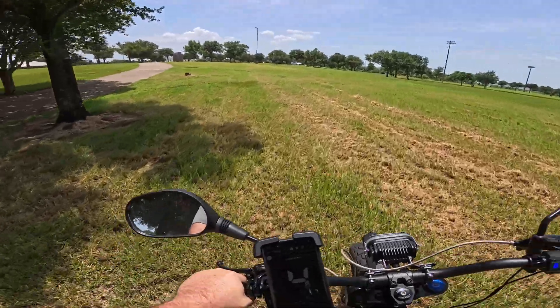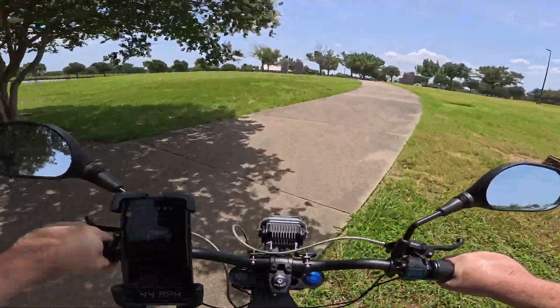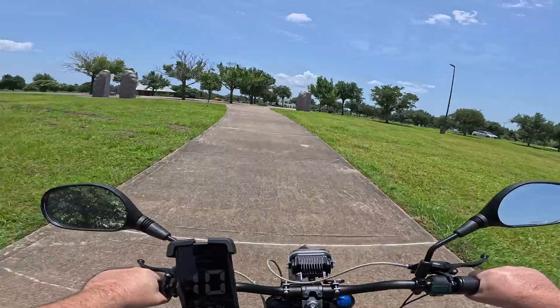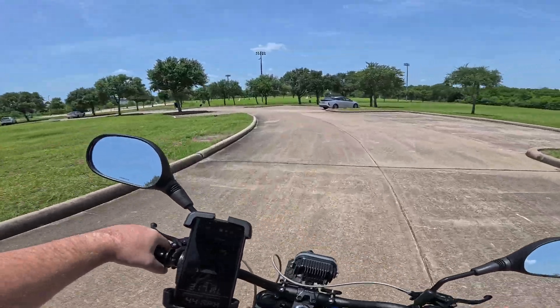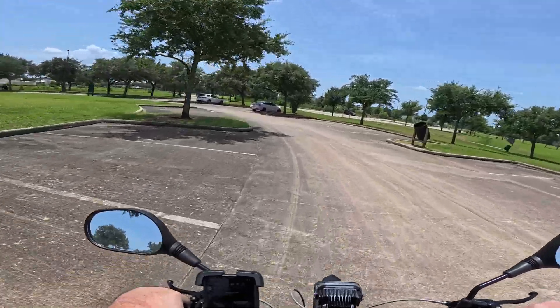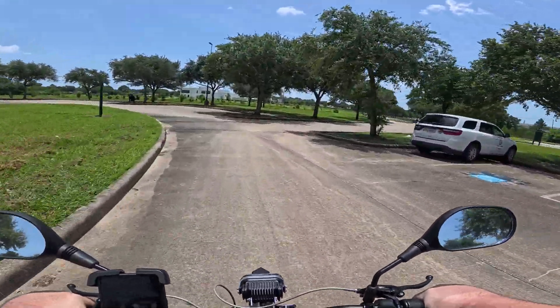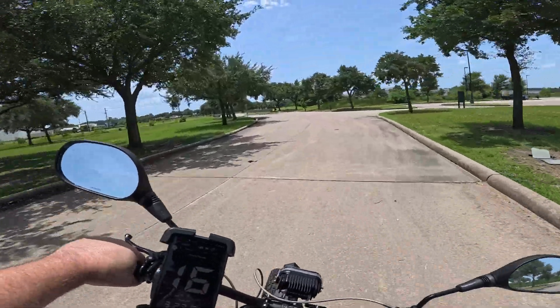If you haven't seen any of my other videos, I actually bought this bike — it claimed to be a 20 kilowatt bike, but it's not. Obviously 160 amps at 72 volts is going to be a little under 12, so it's a 12 kilowatt bike. They were calling it a 20 kilowatt bike because of the max boost current or some crap like that, which is not how you calculate it.